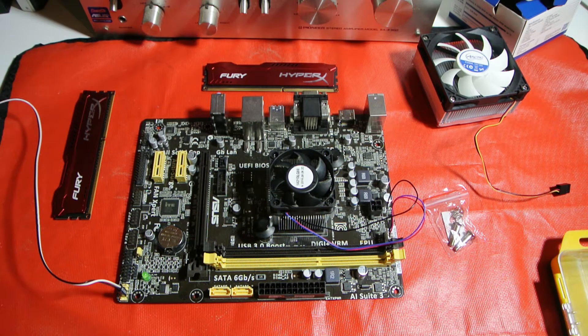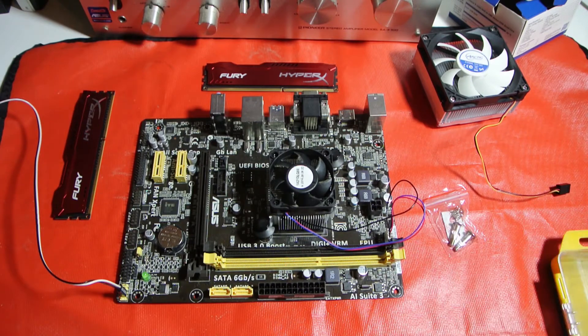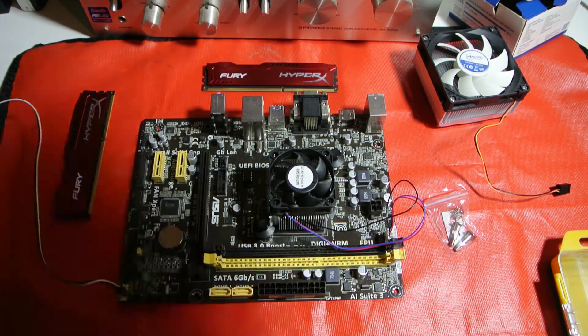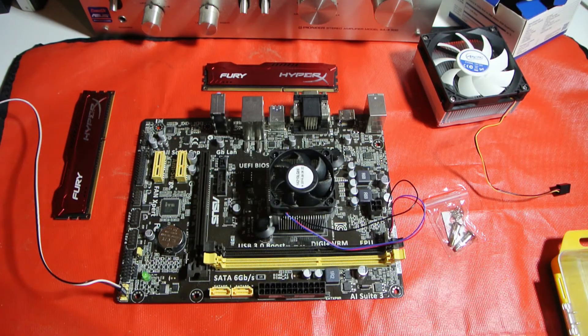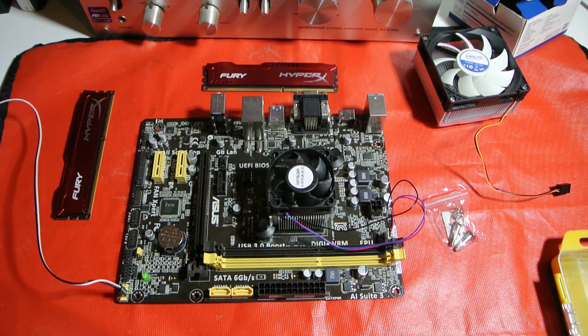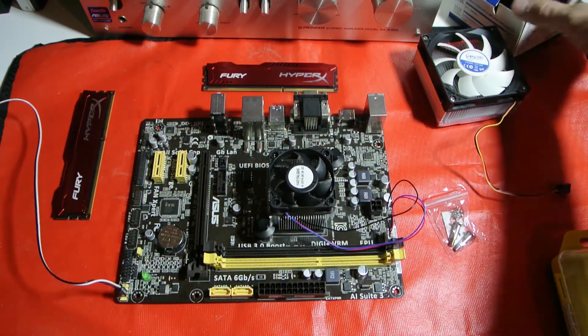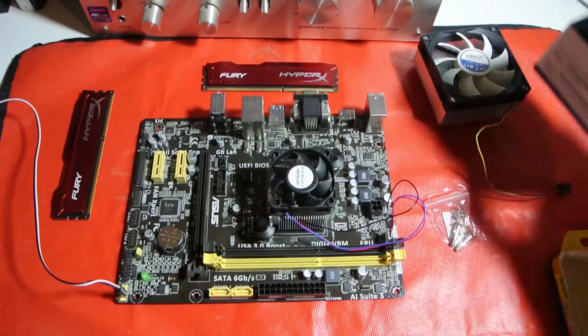Here we are in for a closer look, ready to get the new CPU cooler installed. We need to remove the old one. Just a few things - make sure all the power's disconnected. Good practice to be on an anti-static mat; I know I've been lazy in other videos but I'm doing it now. Remove the RAM - just everything out. And use an anti-static wrist strap to make sure you're well grounded.